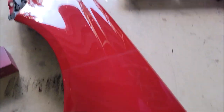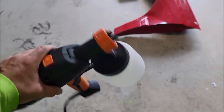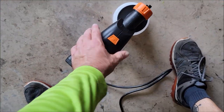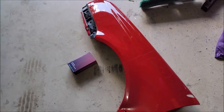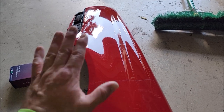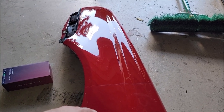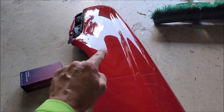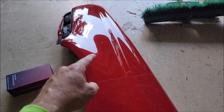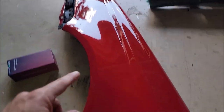What's crazy is when I sprayed that fender, I used this — an airless electric spray gun, basically for house paint. I sprayed my coating on the front of that fender with it and it looks amazing. It was incredibly orange-peeled at first. This is probably six or seven days old now, so it's definitely cured. I polished it with a gloss-enhancing polish using Smart Finish and an orange buff-and-shine pad with a dual action polisher, then wiped with acetone, then isopropyl alcohol, and then sprayed on the coating.